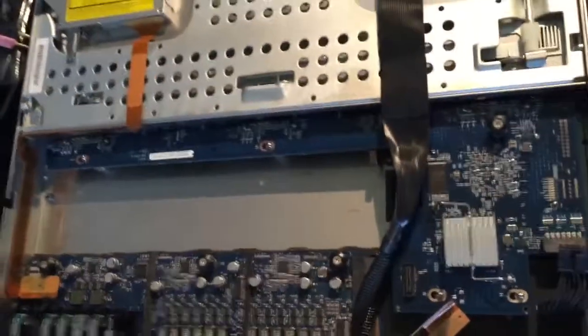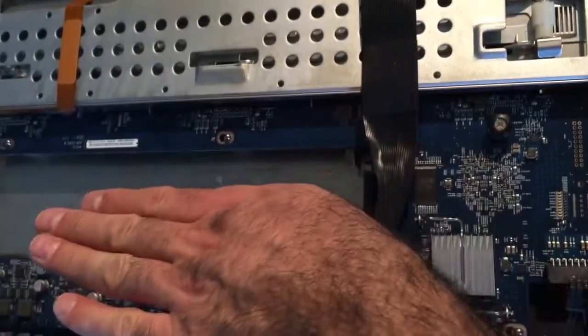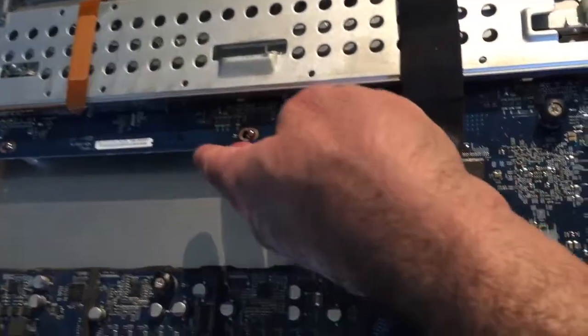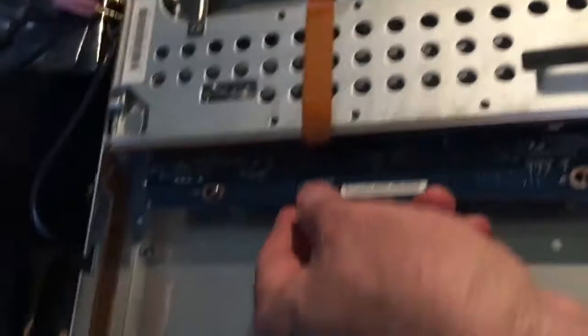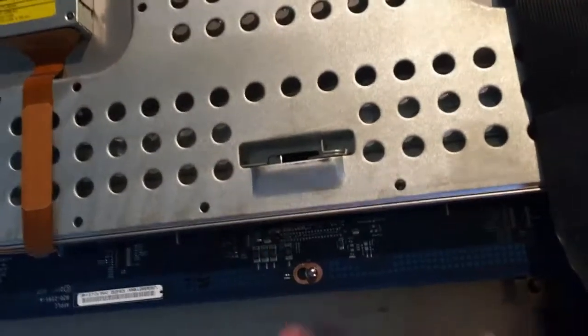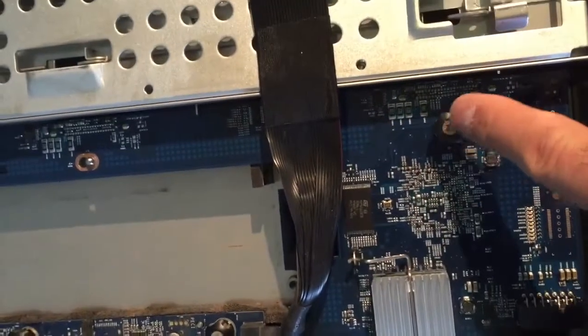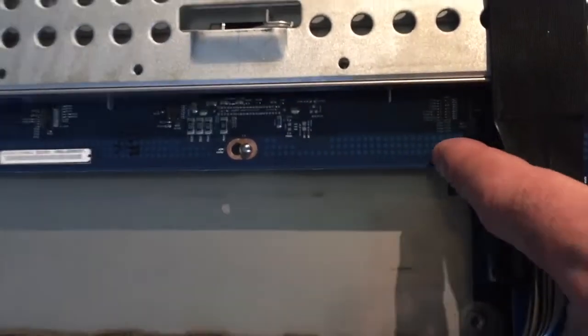There are several U-shaped holders, so be aware of that. The way I got this in was to angle it up coming in, get it into those U-shaped slots first, then once in the slots, line it up over the holes and it just falls right in. Slide it forward away from me and it locks into place, then lock down the screw. Reconnect these connectors — this one and this one — and no connector for the battery since there's no battery on this board.